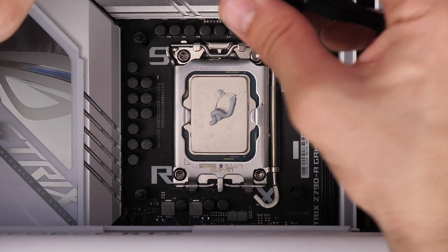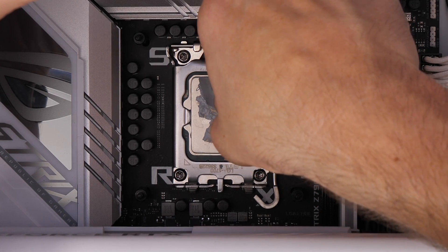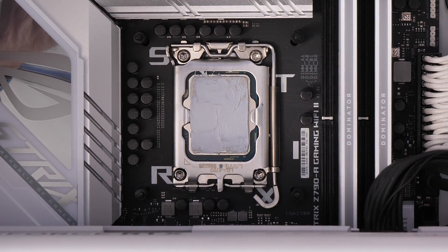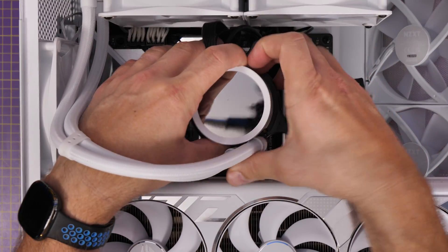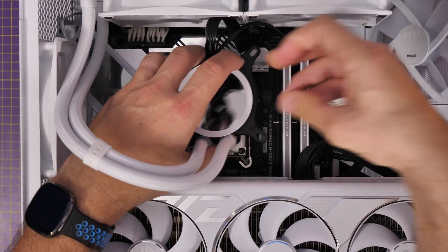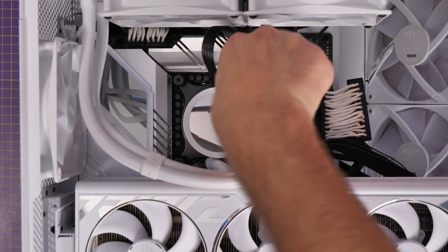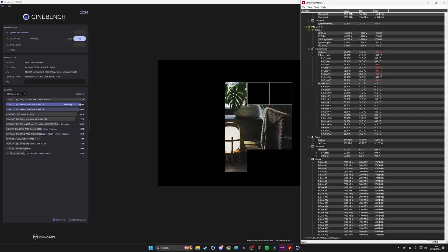I'll note that the CPU isn't running super hot all the time in the original setup, but it does get quite hot under gaming loads and that could be a problem depending on the sort of games you're playing. So I've put the Thermal Grizzly on there with better spread and coverage across the entirety of the IHS to ensure better thermal conductivity. I then reseated the cooler back down and made sure all the thumb screws were tightened nicely for good contact. I ran Cinebench 2024 and unfortunately the cores were still getting too hot — still pretty toasty.